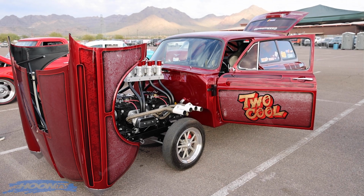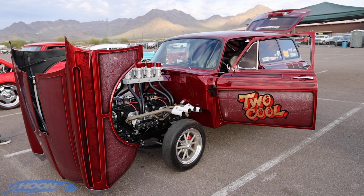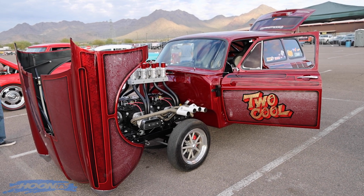And how did you go about the sync up? It all worked out pretty easy. The motors are linked together at the crankshaft. Volkswagen fires every 180 degrees of revolution, so the back motor is clocked in between the front motor, so that it staggers the timing. So it fires a cylinder every 90 degrees of rotation, just like a V8.